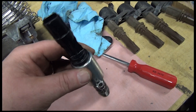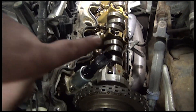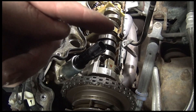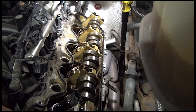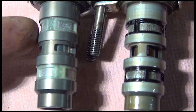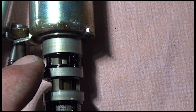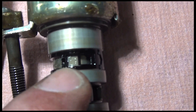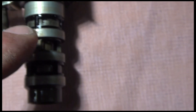This is the solenoid we'll be putting back in — you can see there's a Torx bit. Now here's the one that's in there currently. I'll pull that bit out, this thing will just pop up out, pop the new one in, put the bolt back in it, and then this valve cover gasket will be replaced and put it back together. It's probably hard to see, but this is the new one with the newer style screens versus the older style black screens. If you look at this one — that screen is missing, it's actually ripped out. You can see what's left of it right there; the edge of it is curled up. So hopefully this will fix my tapping problem.